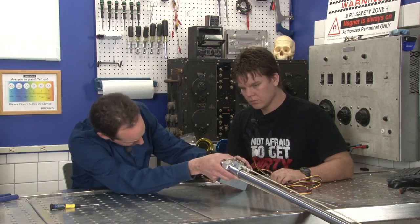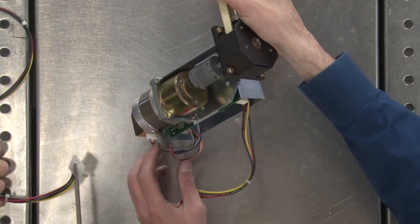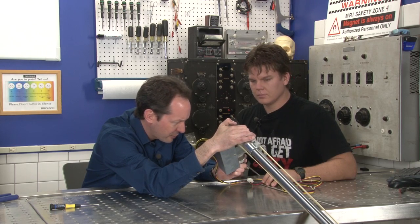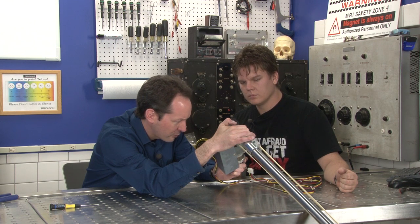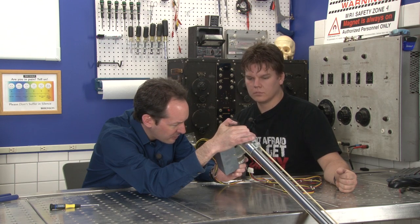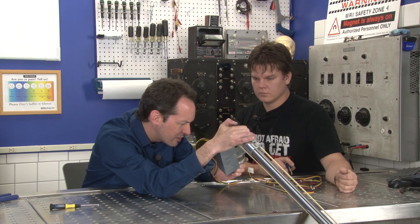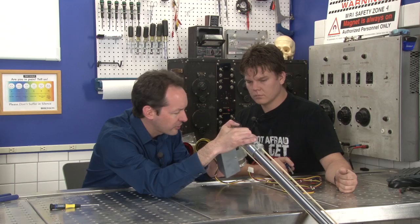Were there any control circuits? Yeah, there were. There's another plug that's all pooched out. So we've got to figure out this motor, and I'm going to give you some numbers here. It says right on it, 12 volts DC, 600 CPR, 19.7:1 ratio, 3/26/2004. The motor model number is GN2342A149-R2. I think that is way buried in there. I think this is just a DC motor.